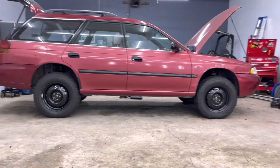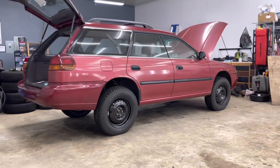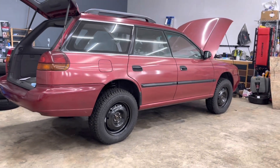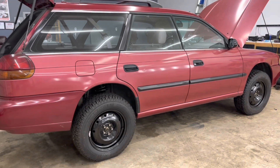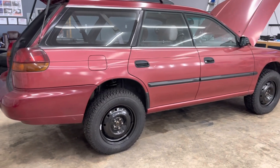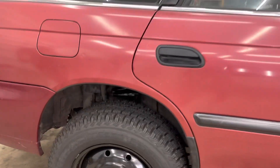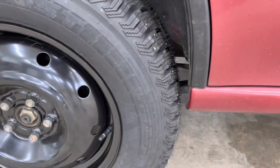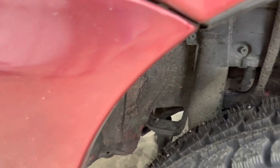That's unreal — definitely got some ground clearance now. That's awesome. We've got to settle these springs out. We still got to go up front, bleed out these brakes, and then go take it for a little drive just a small one until we get the alignment done, and just kind of see how it drives, see if there's any rubbing on turns and things like that. We did put the two-inch trailing arm spacers, because without them we would have been rubbing. I think it's going to settle down at least probably a half inch or so — no clearance issues. So we're going to be fine.